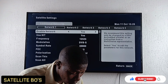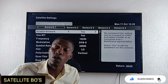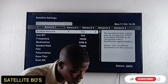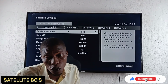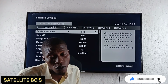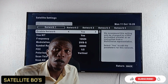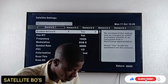Please, after doing this, how can I switch back if I want to subscribe? It's simple, just reinstall your DSTV frequency on your dish and reset your decoder. I was only able to scan network 1 and 2. That's great. If you have done network 1 and 2, you have done a great job. It means networks 3 and 4 will be having issues scanning. All you have to do is to make sure you enter a valid frequency different from the ones you entered for network 1 and 2, on 3, 4, and 5.